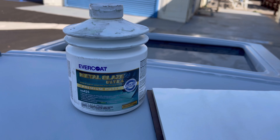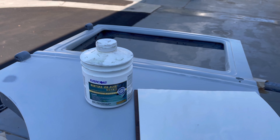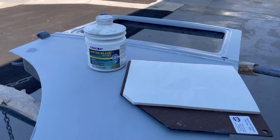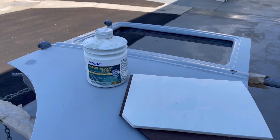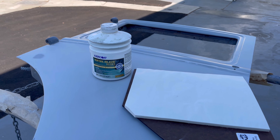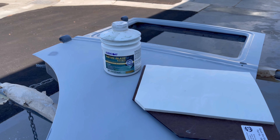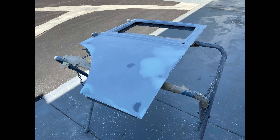I'm using the Ever Coat Metal Glaze Ultra with some quick sheets. Squeeze it out, put a little bit of hardener with it depending on your temperature and how quick you want it to harden, and glaze that on. There's also Dolphin Glaze and other glazes out there — I really like the Ever Coat brand, it's a professional brand. I found that while I like some Eastwood products, I wasn't happy with their glazing putty, and their high build primer just never seemed to cure in my experience and left a lot of seeds. Whereas this PPG primer — sure, it's a little more money — but time is money, and it doesn't seed up like the Eastwood did.